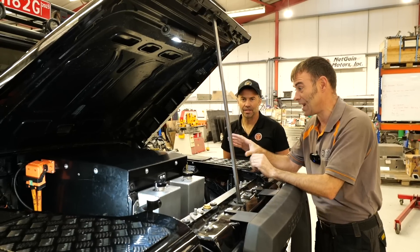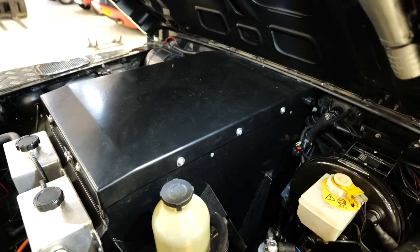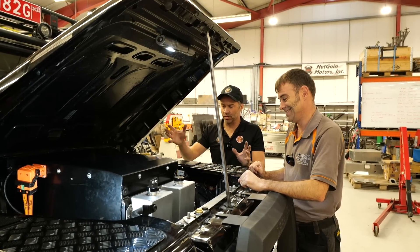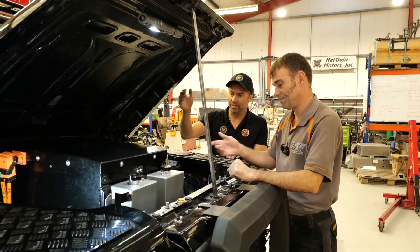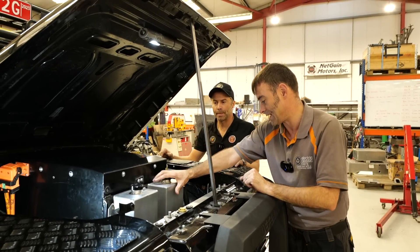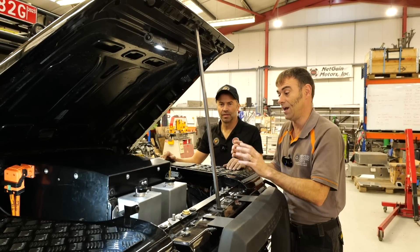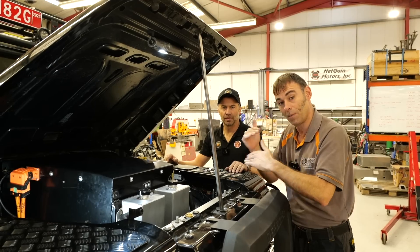The 80 kilowatt hours in the front fits fairly snug — it's not taking up everything. We were really surprised at how well it came in. We also have all the luxury features back in: air conditioning, power steering, power brakes. Up front you've got the header tanks for the motor inverter and for the battery pack, which is definitely required because with a big battery pack comes rapid charging. We've gone for 150 kilowatt rapid charging, which means you really need to be on top of the thermal management side of things.